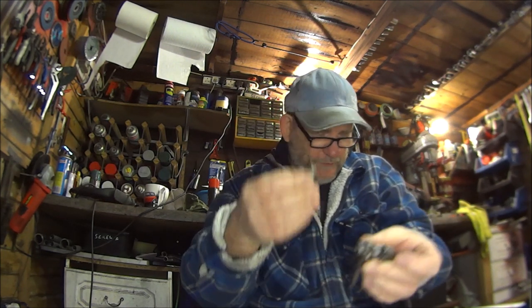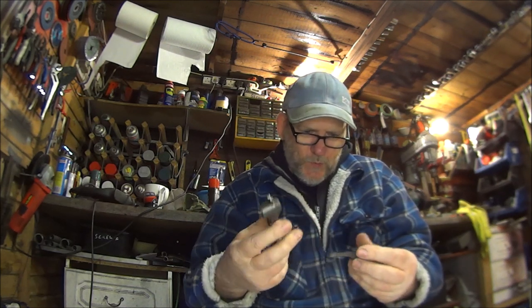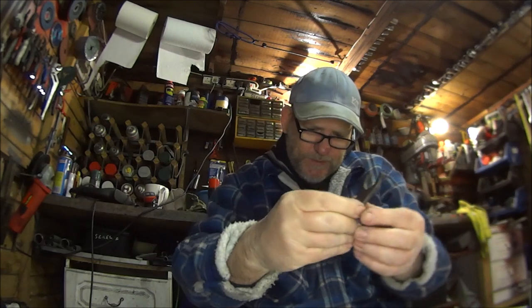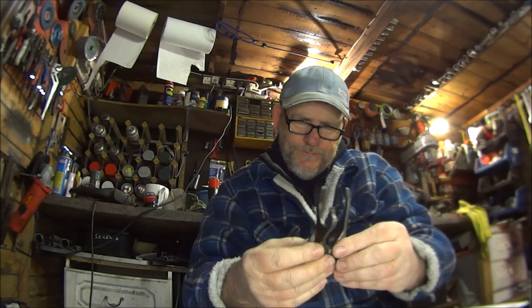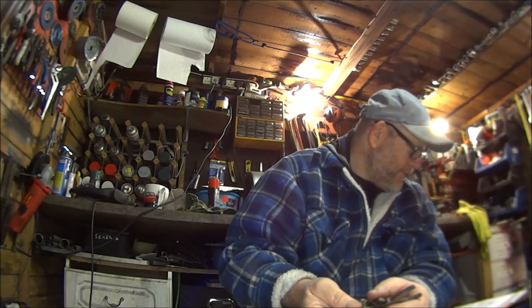And yes, it all worked up to fourth gear, but then fifth gear is a false neutral and you can't go no further. So what I actually did was took it all apart again, and instead of facing the centre to the clutch side, I faced it to the sprocket side. And the other two I faced to the clutch side, like so. Now in fact I don't know what I did. You're confused, don't worry. I am totally confused.